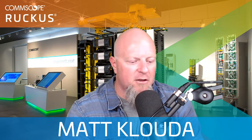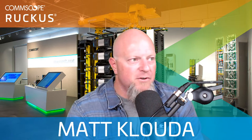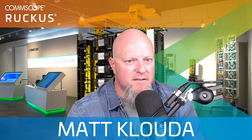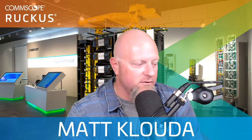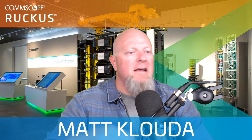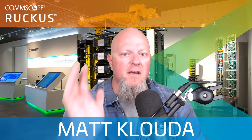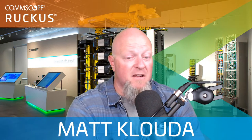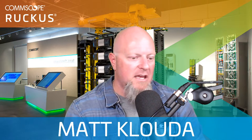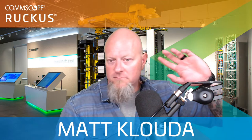My television, my Echo Dot, my Alexa, if my stupid refrigerator decided it needed an IP address to report on ice cubes to somebody I don't know. I don't know why my refrigerator needs an IP address, but anything at all that I know, my security system, everything, it connects on the IoT VLAN. And that's because in pfSense, I firewall it off. It can't go anywhere. It can't touch anything internally. It can get out to the internet. It can go phone home. That's it. That's all I care about.